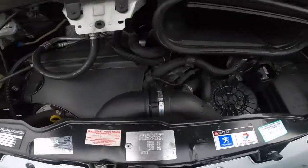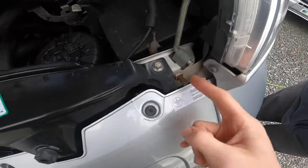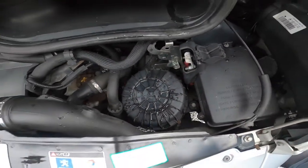Paint code is in there too. And if you ever need to jump start the vehicle, you've got a point by the headlight — the passenger headlight. Underneath this cover is the positive, because the battery is underneath the cab floor.